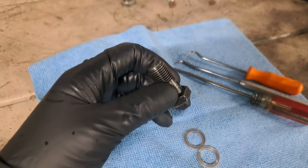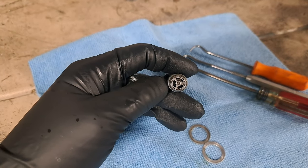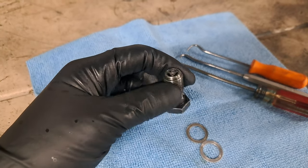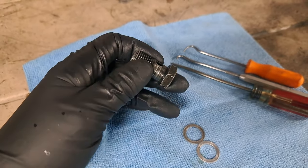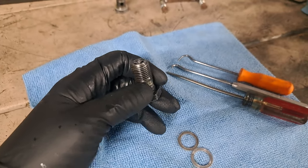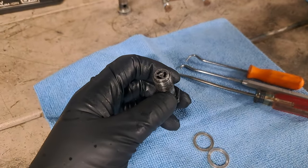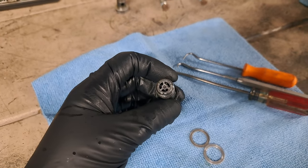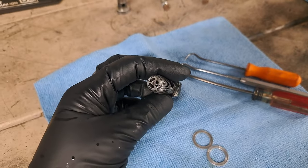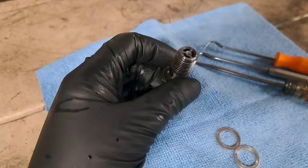The LF-30s don't tend to fail. After removing the restrictor, you can actually feel the difference in the wheel. Don't be discouraged — you'll still have that nice, prominent, stiff steering the E46 chassis is known for, which comes from the chassis and suspension design. You're not going to lose that direct connected feel; the steering wheel will just turn a little easier and you'll still feel planted.